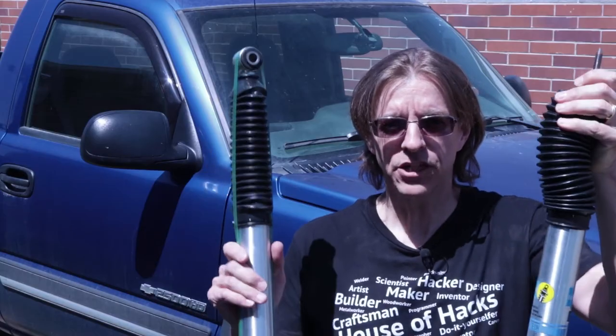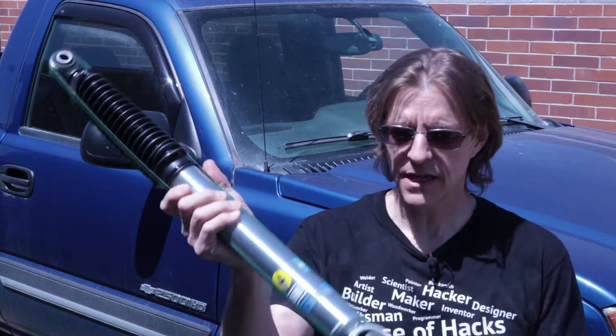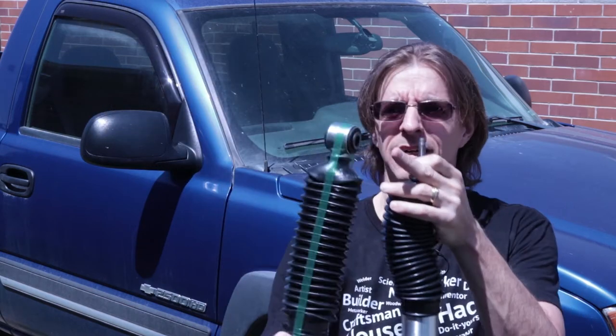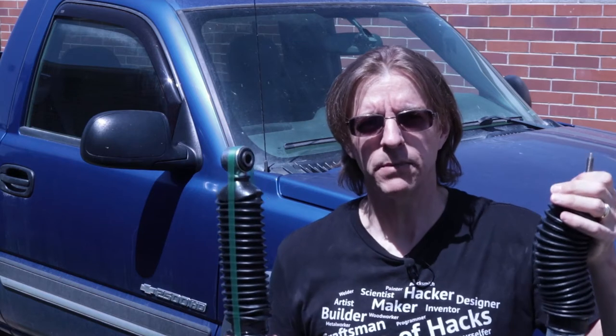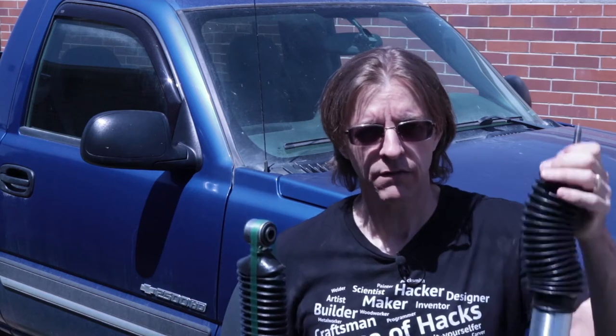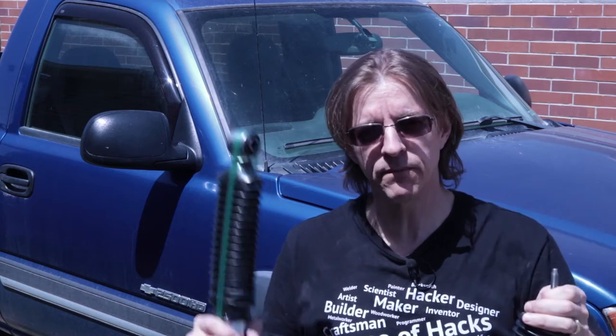Okay, I've got two pairs of shocks. These are the fronts. They have a stud coming out the top. These are the rears. They have two places where the bolts go through on top and bottom. You always want to replace shocks in pairs, front pair, rear pair. I found a place on Amazon, leave a link down in the description below, where they sold a kit of four, two fronts and two rears.